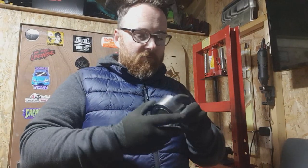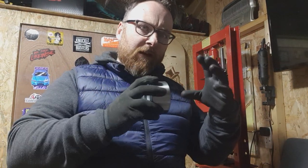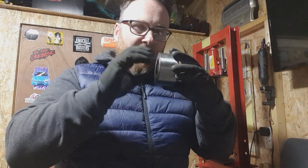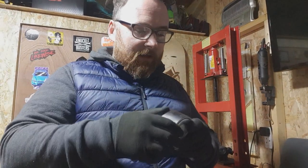So these are modern day automotive bearings. In older cars where you had a long spigot, you'd have an outer and an inner bearing. On this it's all one unit. So you've got an outer and an inner bearing and they're the same size, and you just run the hub through it, torque it all up, and it runs lovely. However, getting it in is always a challenge.